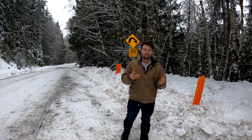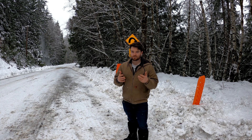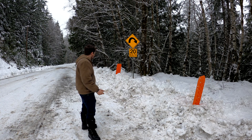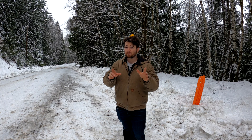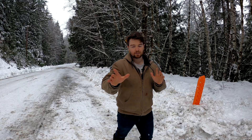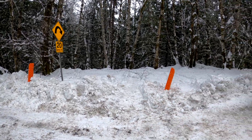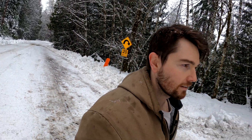The last run in four-wheel drive low did not stop as well — I'm not sure if there's a reason or if I was just on slicker snow. My shortest four-by-four brake test is right here, and my shortest two-wheel drive brake test is about 12 to 14 feet further. So at 40 kilometers an hour there is quite a bit of difference. One thing to keep in mind: we're on a downhill slope, so on flat ground the difference in brake distance will be much less. But the key takeaway is there's quite a bit of distance between where you stop in four-wheel drive versus two-wheel drive, even with ABS on.